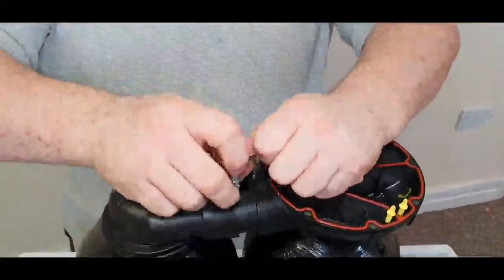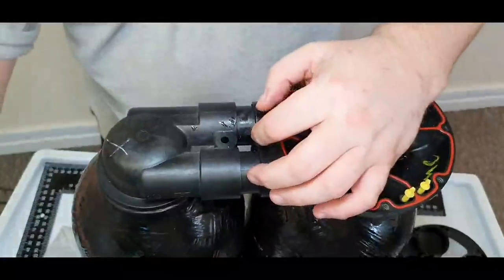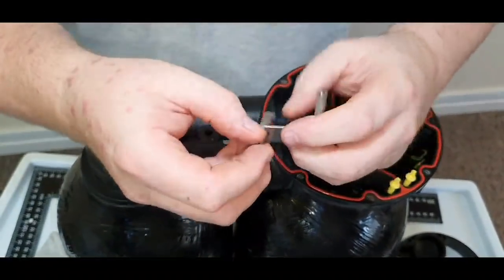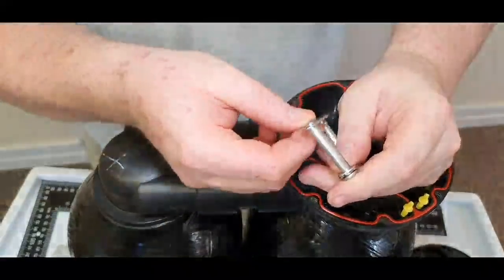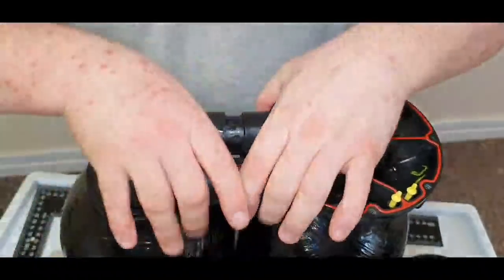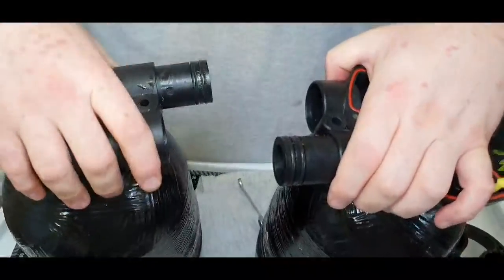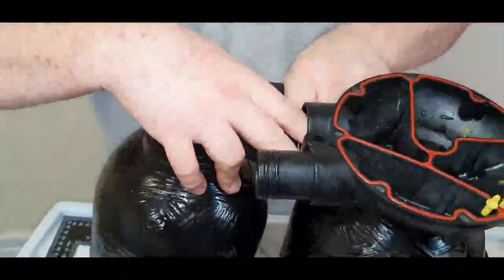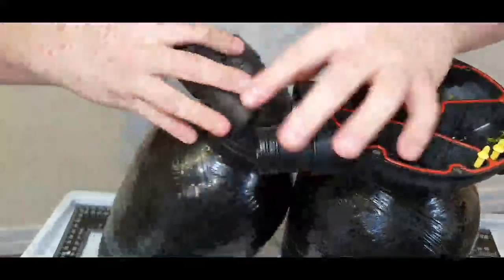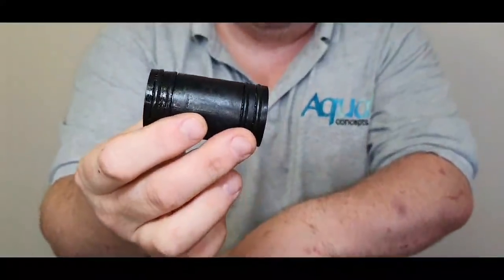With the valve off, we can take away the slave or auxiliary tank. The pins just come out — they've got a little sprung ball bearing and they fit through, connecting with a little bracket underneath. They can just be pushed out and then we separate the two tanks. They're rejoined by two connectors, both with double O-rings.